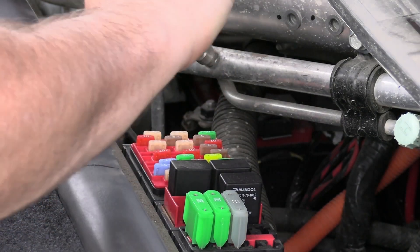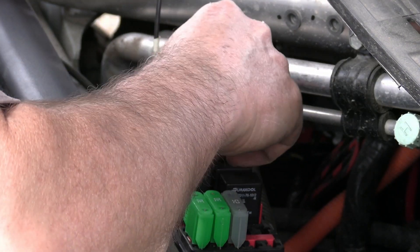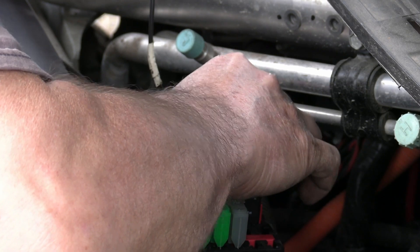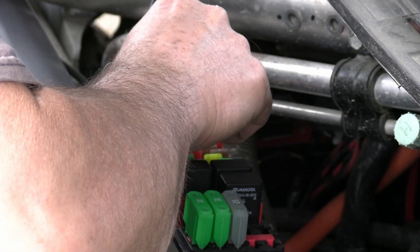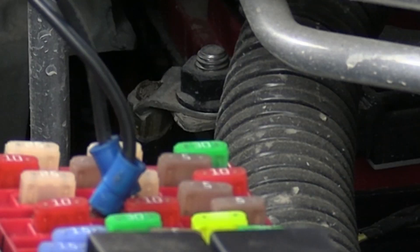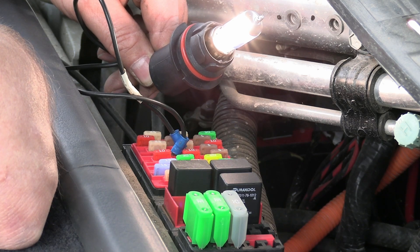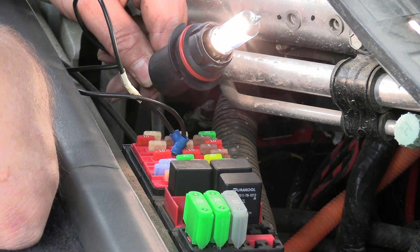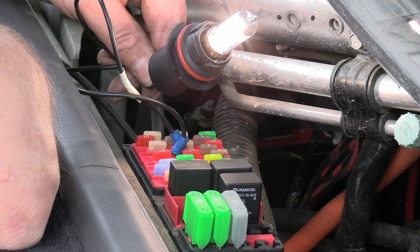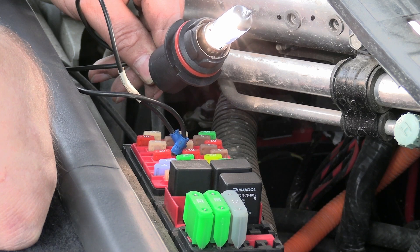So we gotta see if we can get this in here. This fuse box has a red plastic cover of sorts on there, so it's a little tougher to get these two in. And you can see the light comes on immediately — so with the light on, that means we have a short right now. It's full brightness, so we have a dead short right now, and it will blow a fuse right away if I put it in here. This was only a 5A fuse, so with this brightness it will blow right away again.